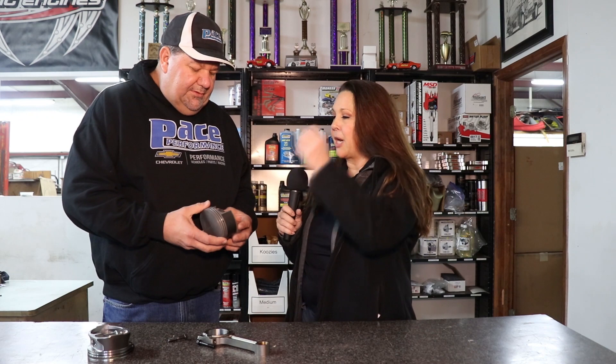With the forged — am I thinking right, like blacksmithing is forged? What is the production process? Correct. This piston being a forged piston goes through the forging process, but it's the same basic material and design we use in engines that make thousands of horsepower. Drag race applications use forged pistons, open circle track engines use forged pistons, and you don't see any durability issues with those. When we went to this piston, it is actually now overkill for the engine, which is a good thing — it gives the consumer a better product with more durability on the racetrack.